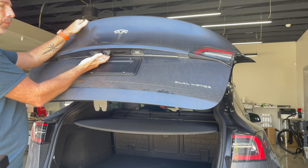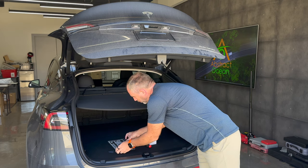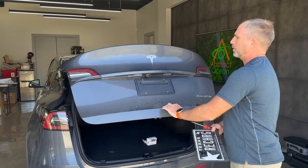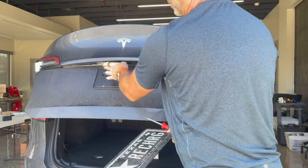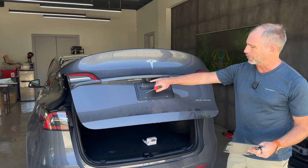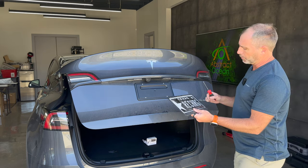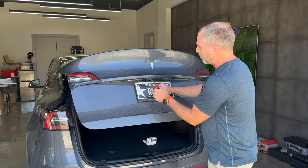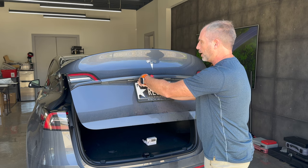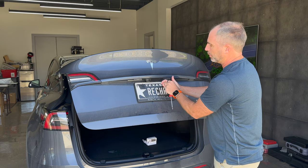Put the license plate back on. In terms of care for the camera cover: this is a fairly aggressive or abused area of the car - air whips over the back and spins around, which is why your rear camera always gets dirty. Rain, sleet, snow, and particulates in the air are what contaminate the surface of anything with a hydrophobic coating. Just like ceramic coat or PPF, over time the water stops beading up. The key thing to extend its life is to keep it clean and wipe it over with an alcohol or lens wipe - just make sure there's no grit on the surface when you do.